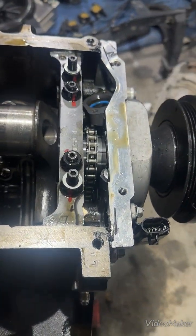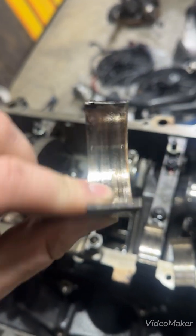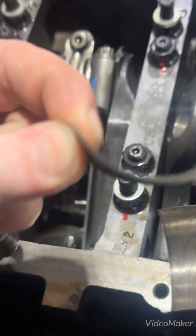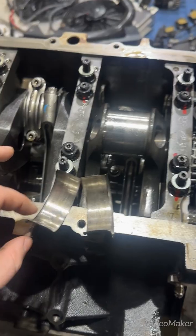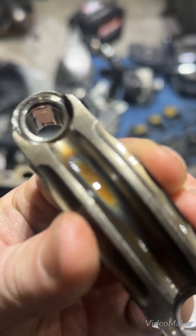A little comparison — you can see the thickness difference. The ends have a little notch that sits into the rod cap; it's notched for it. On these ones, it's completely gone, wore very thin. I knew right away which one it was just because the rod cap has a witness mark from the heat of the bearing heating up inside there.